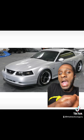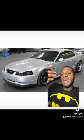The SN95 generation Mustang GTs came from 1996 to 1998, but in 1999 Ford decided to give this thing a bump in power by giving it PI heads — aka Performance Improved heads. Not only that, but it came with a better camshaft, a better intake, a better throttle body. It basically had a better top end kit than the SN95 generation, which bumped the 4.6 2-valve from 225 horsepower to 260 horsepower.